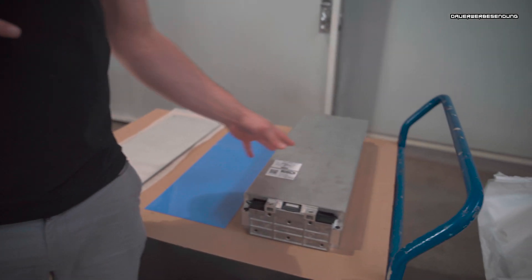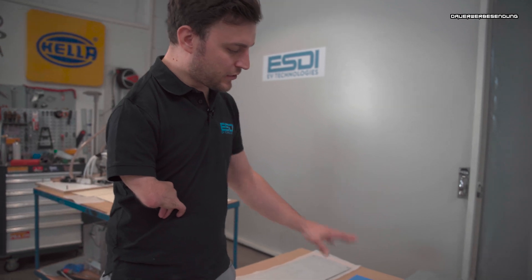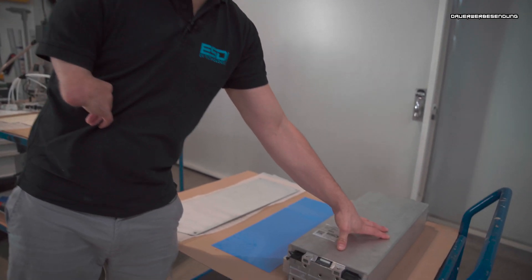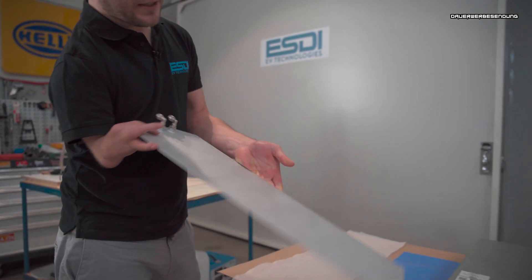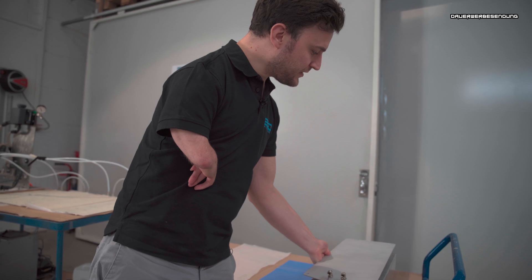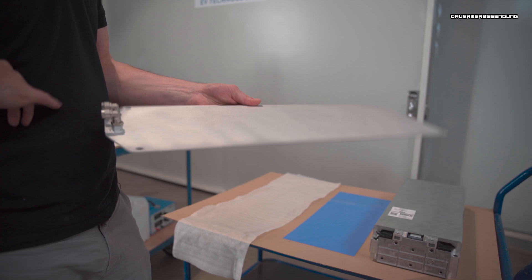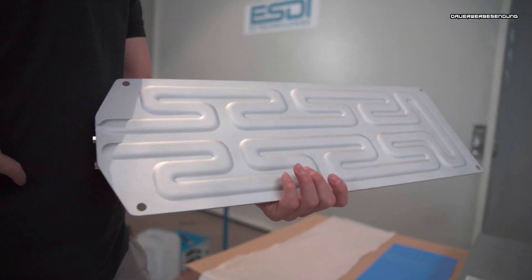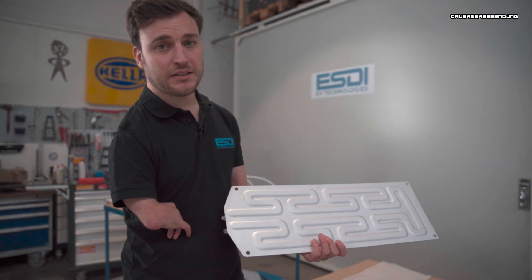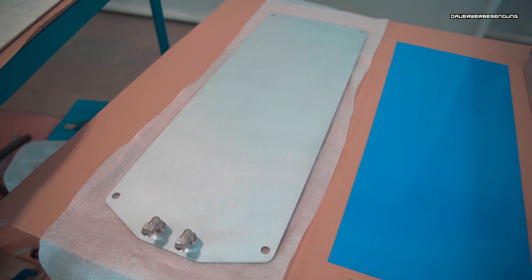These cooling plates are quite big, so mainly you would use them just as they sit — you would not turn them 90 degrees or anything like that. You need one cooling plate for every module. We developed a very light and quite cheap cooling plate that is exactly the size of an MEB module. You can mount them in the mounting holes. Here you can see the cooling channels — we developed this with a university in Germany, optimized in both flow and temperature.